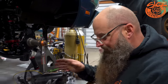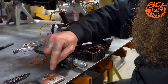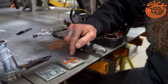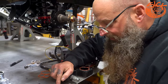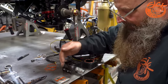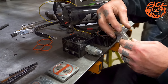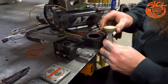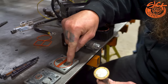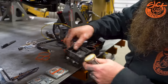So now that they blew this up, I'm gonna rebuild it. What happened is they overloaded the truck with too much stuff and body weight and everything, and they wrecked the little reed valve, it broke off. So the air would compress from the little piston with the umbrella seal on it, and the air would never build pressure and push into the air tanks. It would just bypass and go out the back of the cylinder right here, where there's a little air cleaner.